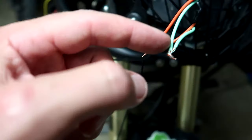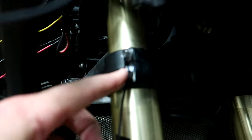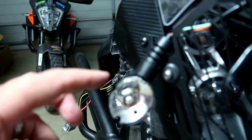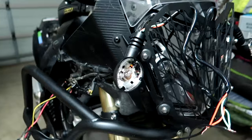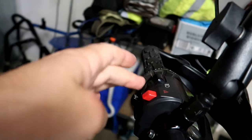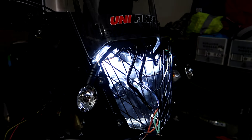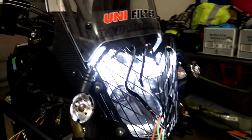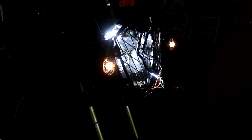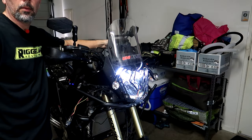The negative of the lights is just earthed — connected to a bolt for now just so it works. The positive goes to the relay. We're going to imagine these are some cool LED auxiliary lights — they're just incandescent indicator bulbs for now. Let's turn the key on. We're on low beam at the moment — nothing weird going on there. Now flick to high beam: you can see the high beams on the main headlight work, as well as the two auxiliary lights. Back to low beam — normal. High beam — auxiliaries come on.